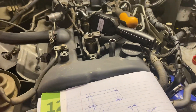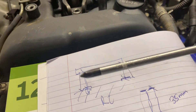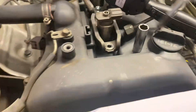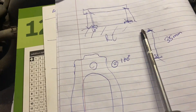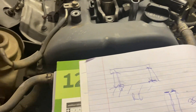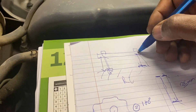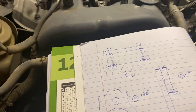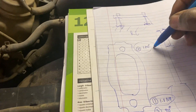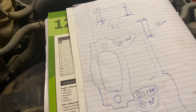What I've done to get that height is use a screwdriver with a white marker on it. I measured it from the bottom to there and it's about 35 millimeters. So 35 millimeters from there to there. Once you get the two bolts at the same height, you tighten the front bolt to 1.1 newton meters, then go to the back one and do 180 degrees, then come to the front and do 90 degrees. That's the way it has to be done.